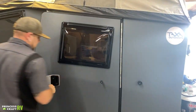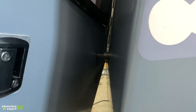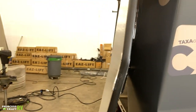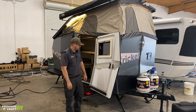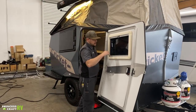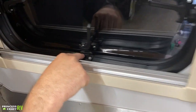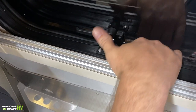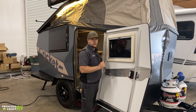To keep your entry door held open, there are two pieces that mate up — just push back and they push into each other with a little pop, and that holds the entry door open. On the inside of your entry door, there's another window with a ventilation feature: on all the latch receivers, there's a middle groove — you can turn the latches down into the middle to prop the window open just enough. It's really good for rainy situations where you still want natural ventilation; you can turn the roof vent fan on and still pull a decent breeze through the trailer.